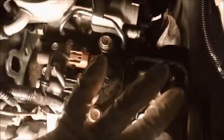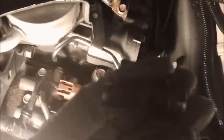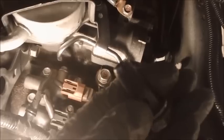And then I have two washers. So one of the washers will go onto the screw. Let me show you. I'm going to put one washer on the screw. Okay. And once I put this screw into this fitting here, I'm going to put the other washer on this end here before I put it into the housing. So just like it came out, there'll be two washers, one on the head of this bolt and one right here, by the threads and that little hole for the transmission fluid flow, okay? So it's going to be two of them.